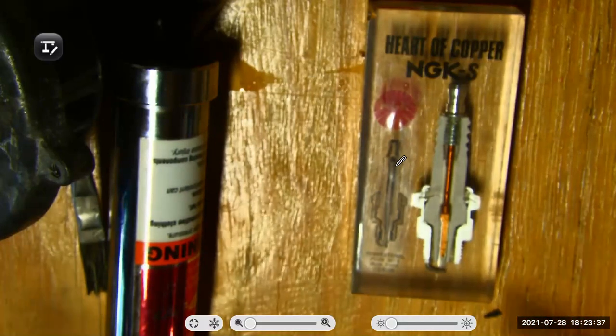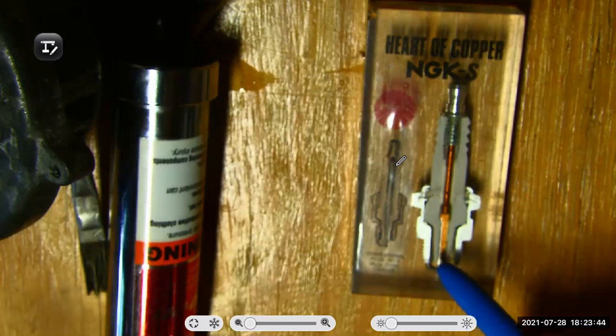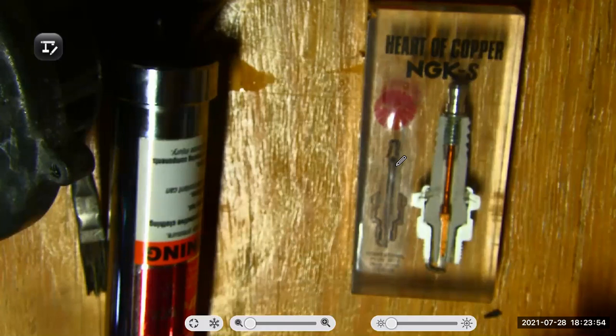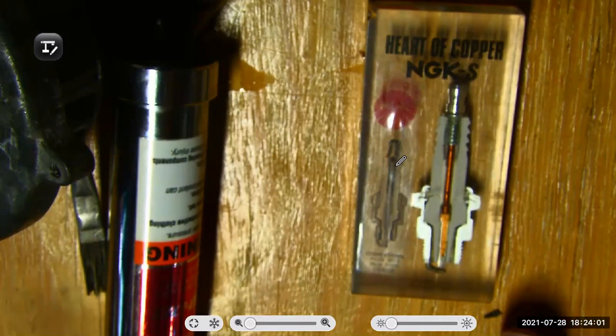And of course, we know there's split fire and all kinds of different spark plug designs, all aimed at trying to make the spark plug last longer, or maybe providing a hotter spark down here. And it's kind of mixed results. I have not really seen, and I've spent many hours on the dyno, both small engine dynos and automotive chassis dynos as well, I've had a hard time actually seeing differences between different spark plugs, other than in whether they're platinum or they're standard or they're split fires or they're not.